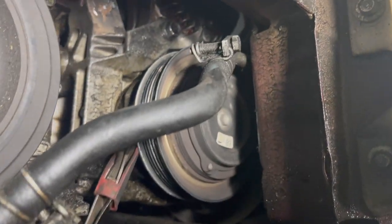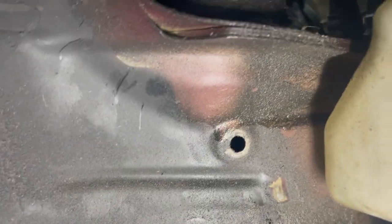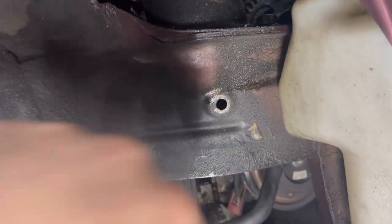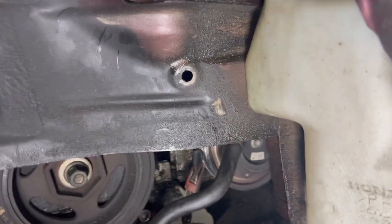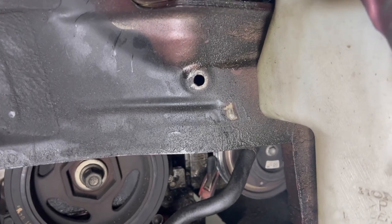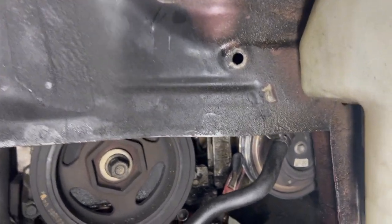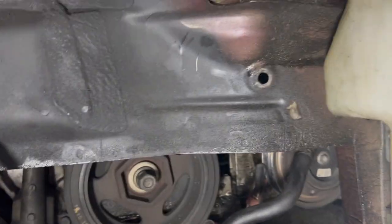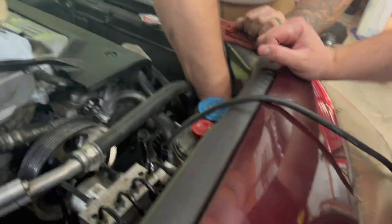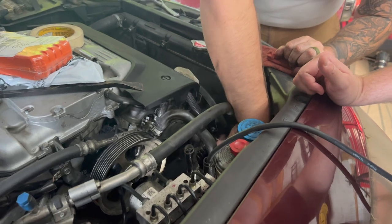It's hard to see, but yeah, right up in there. What I'm thinking is, I got a drill bit extender on the way. Drill a small hole right here, drill a little bit into it, and then use a left-hand drill bit or an easy out, which I have both, and see if that works. But I'm gonna tackle this tomorrow. I'm gonna have my brother here, and Max. So we got three sets of eyes on it and somebody to film, so it might be a little bit better. And see if we can't get this going. I've delegated work. We've all busted a nut here. So now we're gonna take the bracket off because I didn't realize it was a bracket. So we can call this plan B.